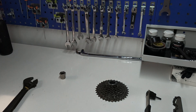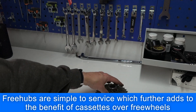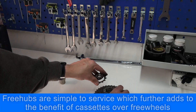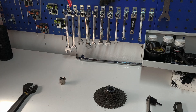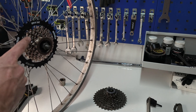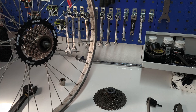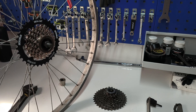With cassettes, it's going to be obvious when they start to wear because you're going to have a skipping and jumping chain, which I've explained in another video. You can also adapt and customize your gear setup and gear ratio by changing individual sprockets if you wish. Anyway, that's the main difference between the freewheel and the cassette. In another video — check my links — you'll see how to remove the freewheel and indeed the cassette from a bike. I hope that all makes sense. Thank you so much for listening, don't forget to like and subscribe, and I'll see you next time.